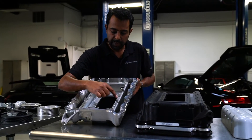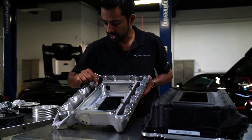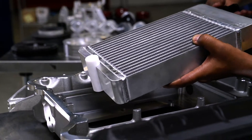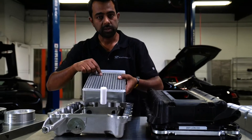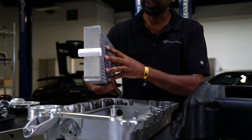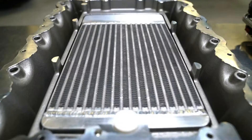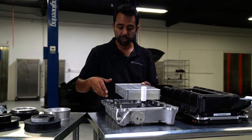You'll also notice these pads — they're not there for looks. They serve a very specific purpose: they retain the fasteners that the base plate mounts to the engine. You'll also see there is a cavity inside the lid which allows for an air-to-water heat exchanger. This is used to extract heat from the air charge before it enters the engine, based on the principle that the cooler the air charge, the more power it will promote. The actual core has coolant circulating through it via an isolated cooling system that's also part of the supercharger.